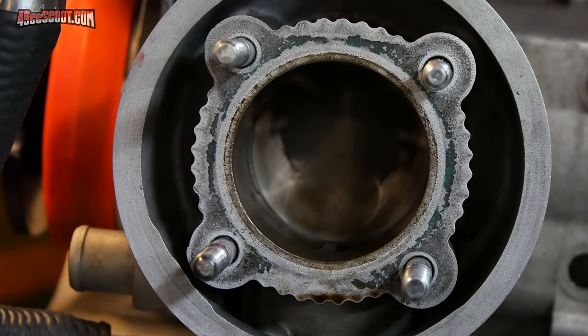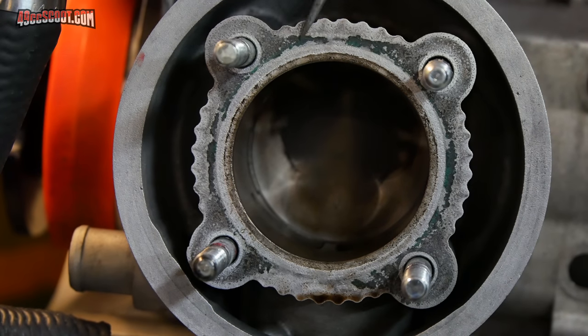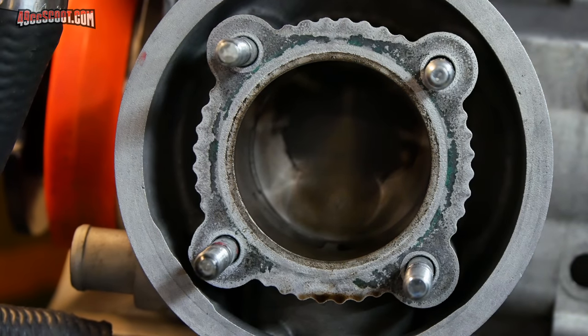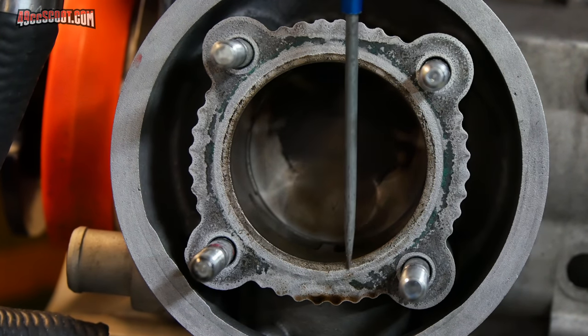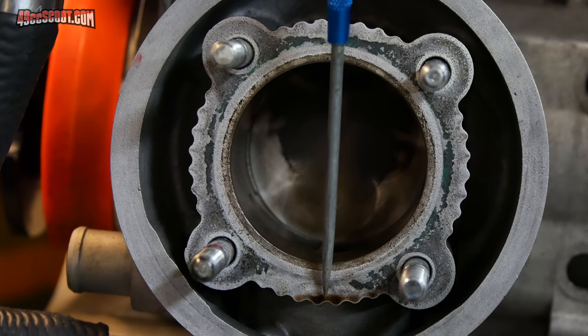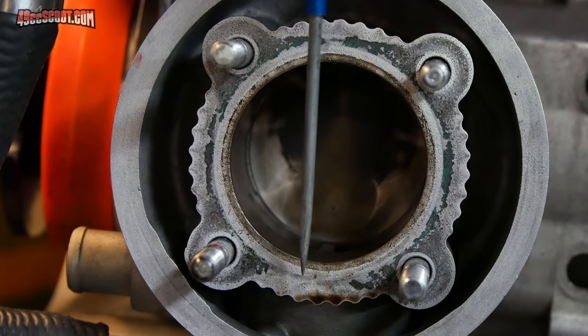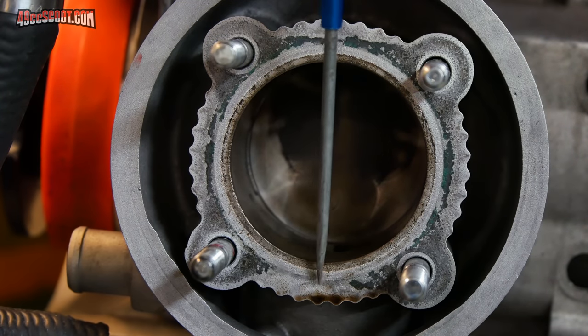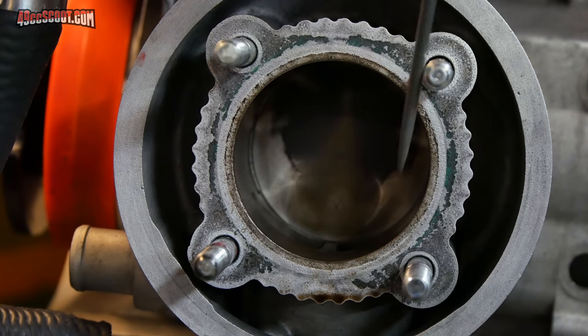Looking at the top of the cylinder, when I check out where the stud and bore O-rings are, I can see lines of separation there on every single stud. So it really doesn't look like the failure points were right there, as I suspected. Once again though, right here at the bottom of the cylinder, you can see that I've got some gas and oil pooling down there, which something like that could happen when you pull a cylinder apart, because naturally everything's going to drip down. But you'll also notice you don't have all the evidence of contact here that you've got all the way around the rest of the cylinder.